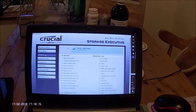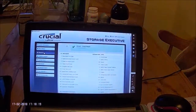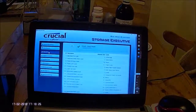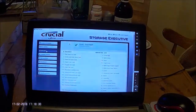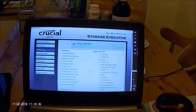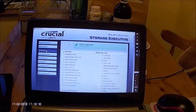Lastly, remember that you do not need to defragment a solid state drive. The reason being that it works entirely differently to the old mechanical drive and defragmenting it is pointless. However, you can defragment the registry, as this only involves a small portion of the disk being read and written to.